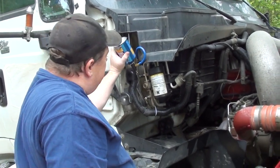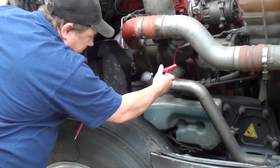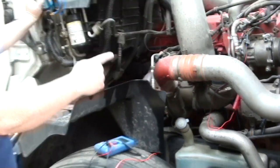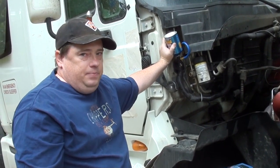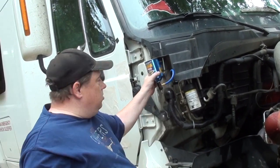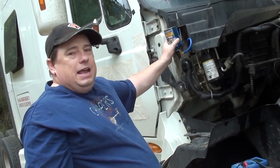And now what I do is I lean against the side, and I come over here with my little alligator clip, and I clip it on that clutch, and I watch it kick in, okay? Now with that clutch kicked in, it's going to suck the refrigerant right up out of this can, and you're going to feel that can get lighter, and it'll start getting really cold right down there on the bottom. You'll be like, whoa, that's getting really cold,